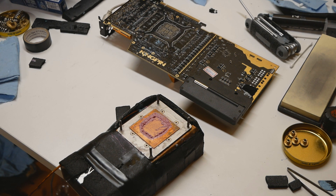Still, the outcome isn't perfect because it keeps cracking. I've tried different thermal pastes and I have no idea why. I think the cracking is related to the card bending when very cold, because the thermal paste cracking almost always happens at idle, not under load. The usual case is you crash and then you get a thermal paste crack instantly afterwards. If you watch extreme overclocking videos by Biso Biso or Rauf from Sweden, you can see they pour down to full pot during the loading screen to minimize cracking risk.